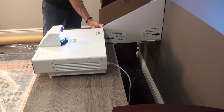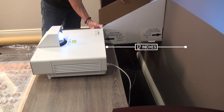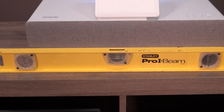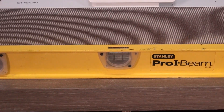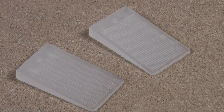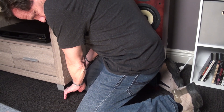The throw ratio on Epson's lens is longer than some other UST projectors, so it does get positioned a little further off the wall. For a 100-inch screen, the back of the projector sits 17 inches away. This is also a good time to make sure the surface of your furniture is level. You'll be able to use the adjustable feet on the projector later to fine tune its position, but starting out with a level mounting surface both left to right and front to back makes for an easier installation. I ended up putting some plastic shims under the footing of our AV cabinet to get it straight. If you do level the furniture, recheck the image width again before the next step.